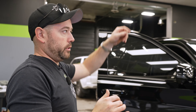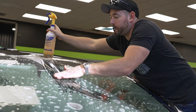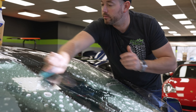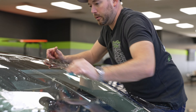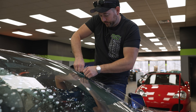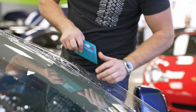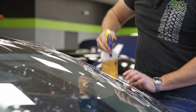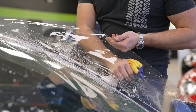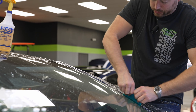Your fingers are wet but you can touch the corner — it's going to get cut off anyway. Whatever you do, don't drop it; you only want it to touch the glass when it's time to touch the glass. It needs to go all the way down in there. It's going to fold up weird and that's okay — we're going to spread the tension out the best we can. There's a lot of dry area that I'm just trying to shove down. Typically that would create some major issues with a PPF-style adhesive, but window film not so much — it's a little bit dry and this is reacting more like window tint, which is good.